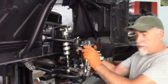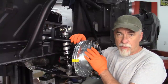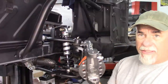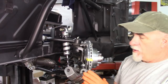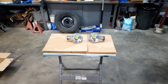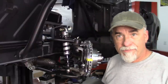At this point I need to take all this back apart. I'll pull off the caliper, the rotor, and then take apart the spindle assembly — disconnect the ball joints. I'm not going to take the arms off. I will be painting these new spindles; they can't be left bare or they'll rust. I'll de-grease them with some lacquer thinner, then use the Harbor Freight chassis and grille paint that I've been using — it's designed for rough use and looks really nice.